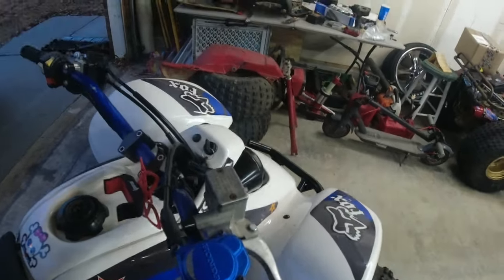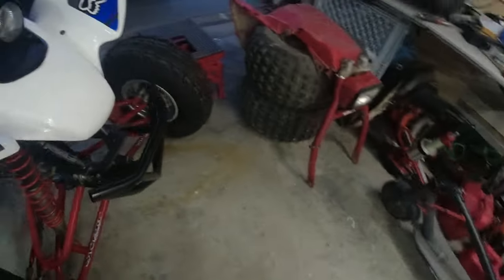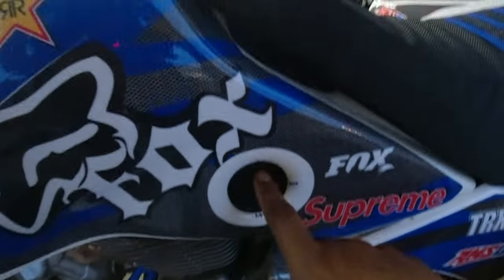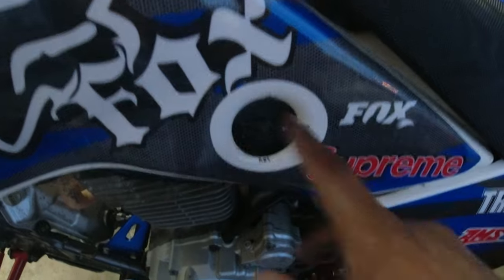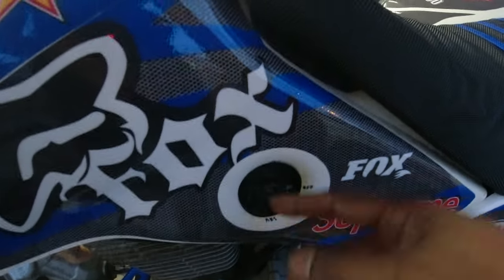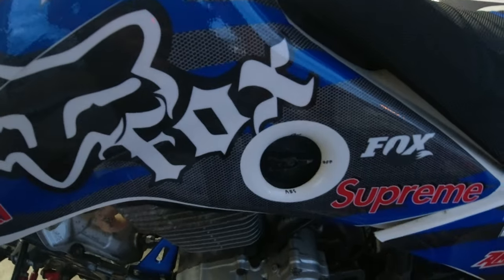The neutral light was staying on all the time when I got it, but when I pulled up the wiring diagram it was just unplugged — I plugged it back in and it was good to go. The next thing was they had the fuel petcock knob installed 180 degrees out. I took it off, marked the correct orientation, and labeled on, off, and reserve so I know where it is, because the first time I tipped it up gas started draining in the off position.